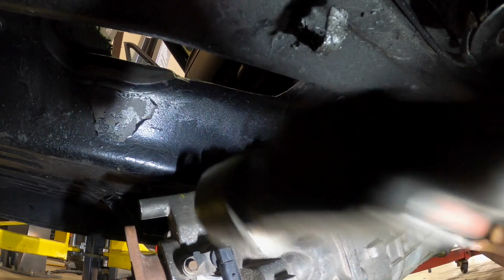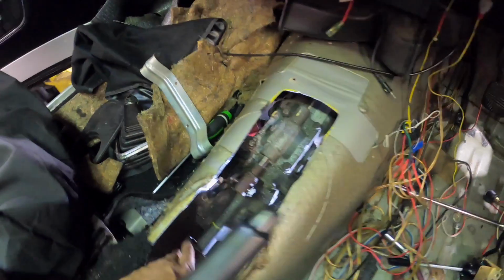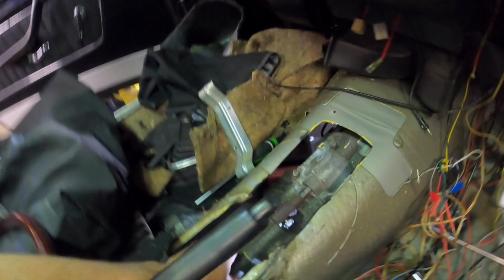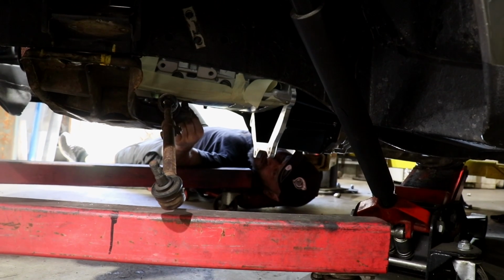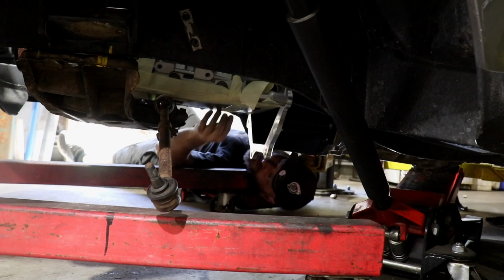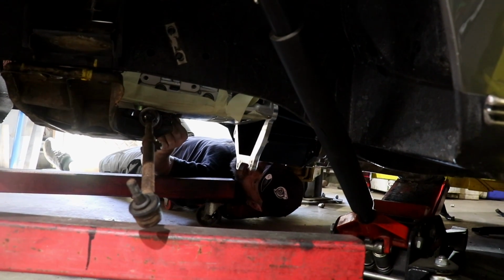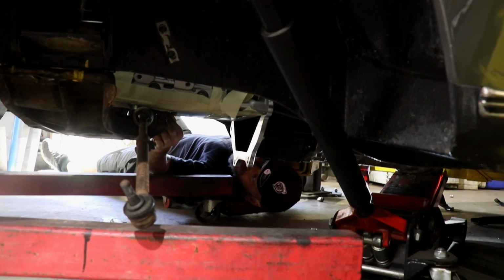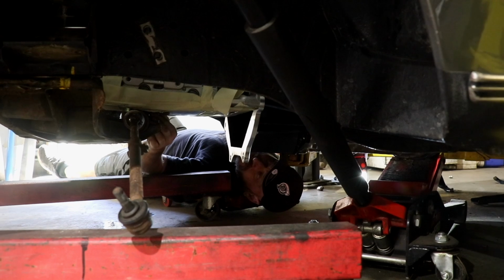We're going to be using an aftermarket Mallex shifter, so the standard remote shifter mounts are snapped off as they were hitting the floor. Height is okay as far as the rack goes. Well, the sump will have to be virtually flat at that point, but that column's going to be an issue though, that back right of the head there, so that's going to have to come up more than it is now.